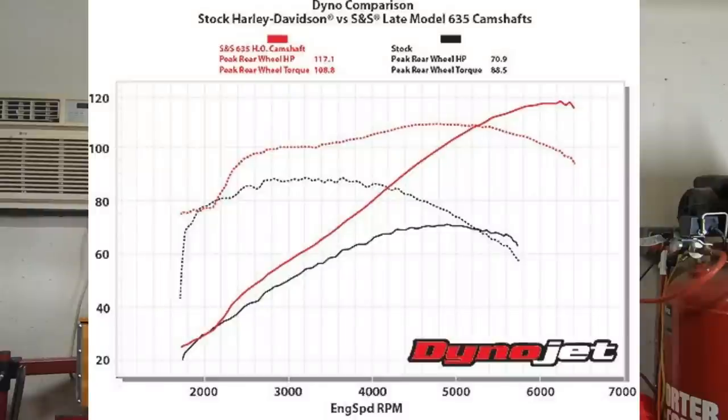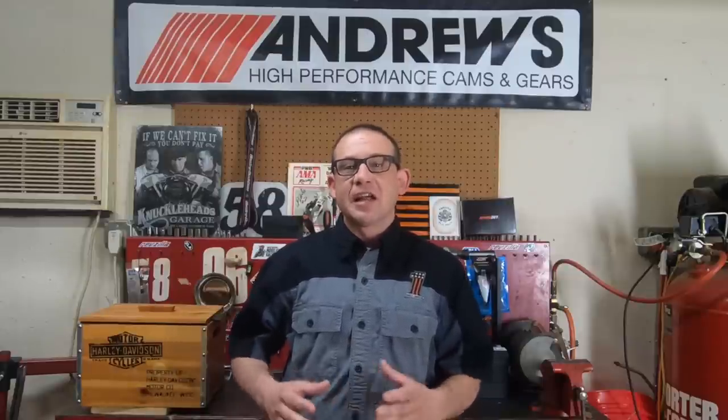Does it hurt anything? Not really. But if you go and put a high lift cam in there, or even just a bolt-in cam, you have to remember these are way more aggressive than what the stock cams are. So you're automatically going to have a little bit more valve train noise. You can quiet down that normal tick from that shaft rotating with a set of rocker lockers.